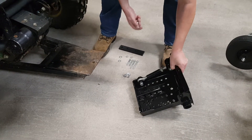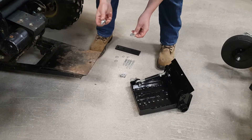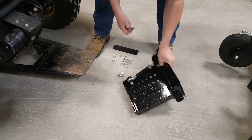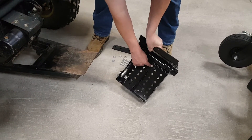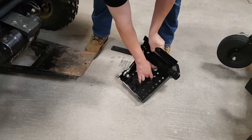So this is the Quick Hitch here. The first thing you want to do is take this half-inch by two-inch bolt that came with your kit — there's one hole right in the very front of it here, and that hole lines up with the main pivot point from your snow plow, so we'll just put that bolt in there.